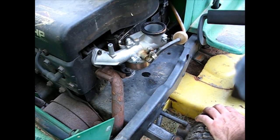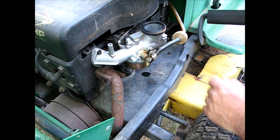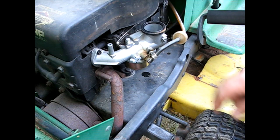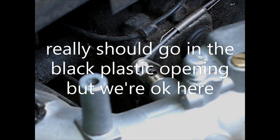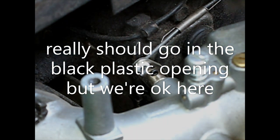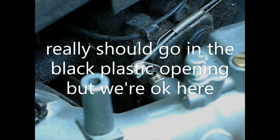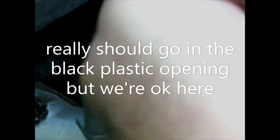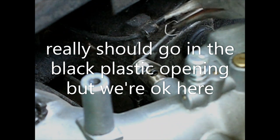Okay, the choke does close when I go all the way up. I'm going to start by putting that spring on there, that anti-vibration spring. That's not the issue, but it could be an issue. Try to get you a decent shot there. So this little spring goes around the shaft, and it prevents it from chattering when it's running. I'm going to reform it a little bit with my finger. It's a very, very thin spring. Try to get in here with these angled ones.